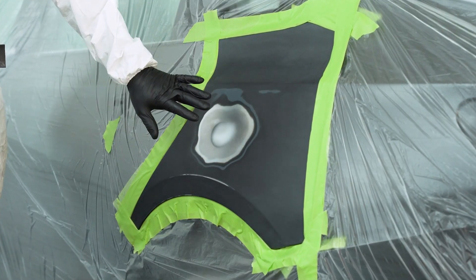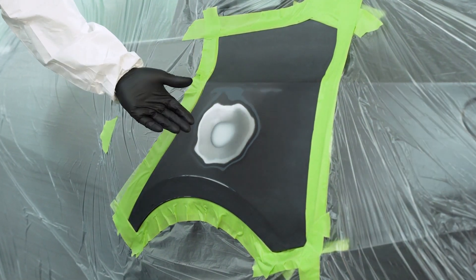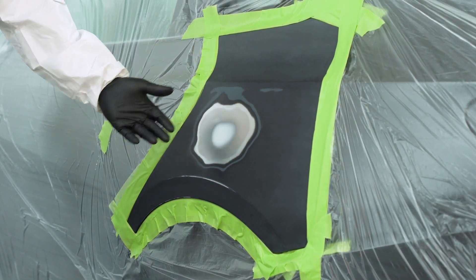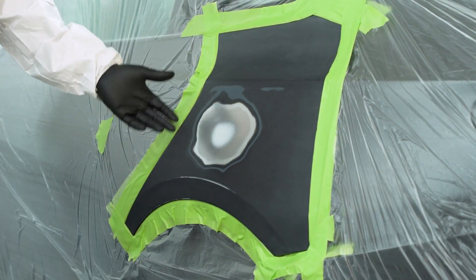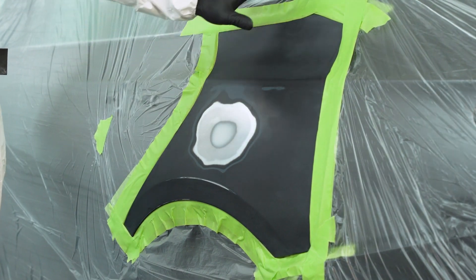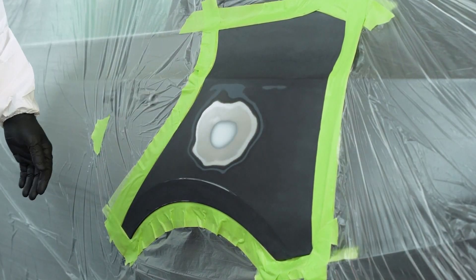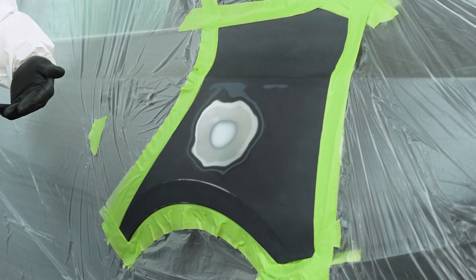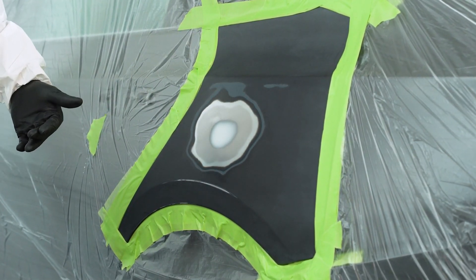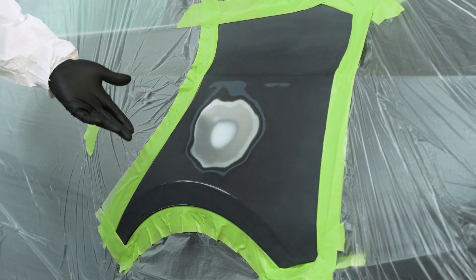Now let's get this car inside. As you can see, we had a damaged quarter panel where we're doing our repair, and where there was a dent we applied some filler and blocked that out to 320. Surrounding that, we also used a DA to prep with 600 near the repair followed by 800 further out, because we don't want any shiny paint as we're going to be applying this primer. Today we chose to do an etch primer followed by a urethane primer surfacer — that's pretty common in most production shops. If you have the time, epoxy primer will also work.